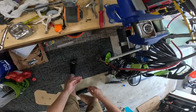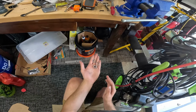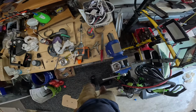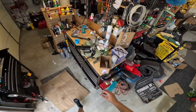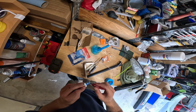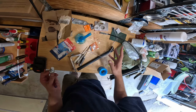So when you finish drilling, you'll feel a substantial pop, and you'll also see the top locking ring separate from the bottom locking ring, and it just looks like two circular pieces of metal. So once those are separated, go ahead and clean out all the metal shavings, and if necessary, re-lube that top ball bearing. Go ahead and grab your Crazy Cart kingpin that you removed from the stock caster.